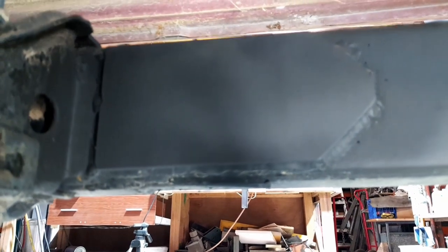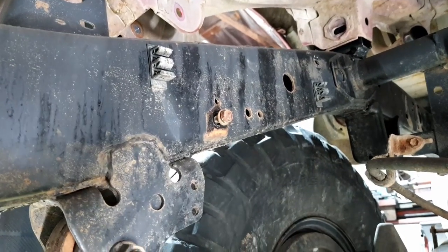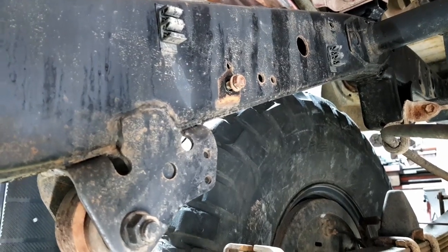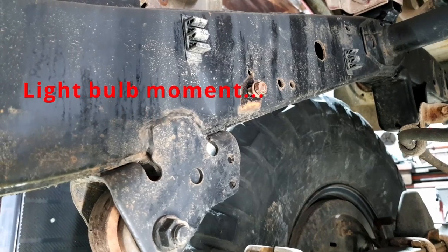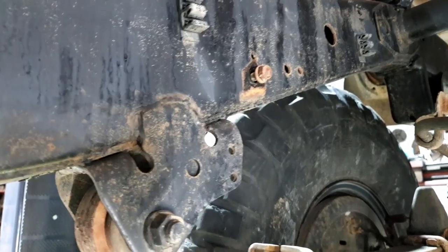So all the front may be right, because there's all sorts of things along there, and clips and stuff to clip it to, like there's a clip just there. So there's a bit of mucking around on where it all goes, but because I've got 400 mil to play with, I might be able to send this line straight up to the master cylinder. Actually, that might work. Okay, so I'll do that.